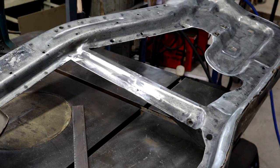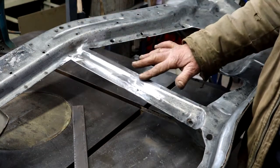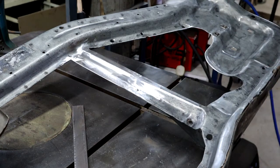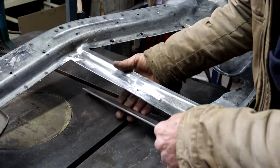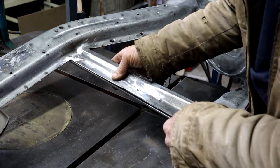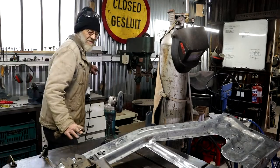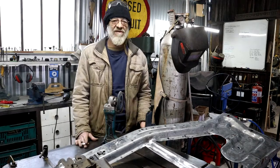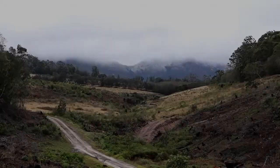I grinded it on this side - this is the side facing forward on the outside of the front apron, whatever we call this thing. This material is quite thin - it's the same thickness as the rest, which is about 1.6 millimeters. Because the radiator actually bolts through this, I do feel it's a little thin. So I'm going to back it up by welding in this piece of flat bar like so, to give me a bit more meat. This is a piece of 30 by 6. My wife tells me today is the coldest day in South Africa in the last 10 years according to the news. While the rest of the nation is sitting in front of their fireplaces and heaters - what is this asshole doing? Working metal. Look at the snow on our mountain.